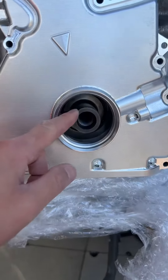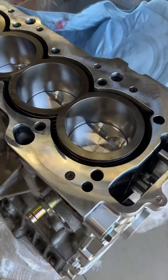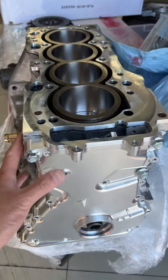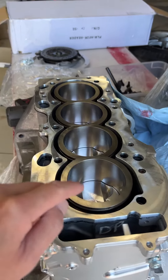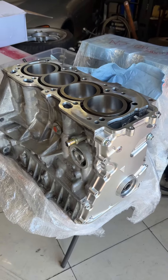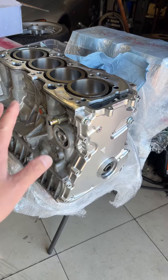That means we are able to use a K24 crank, K24 rods, and K24 87 millimeter pistons. The block itself doesn't know the difference — whether this rotating assembly is in that motor or in this motor. And that's what we made here: the Honda F24, is what I like to call it.